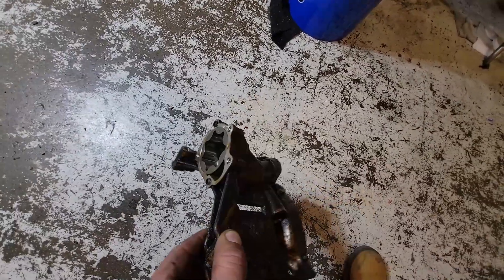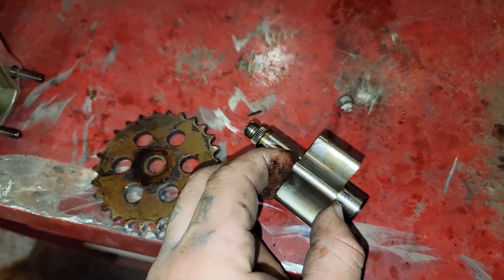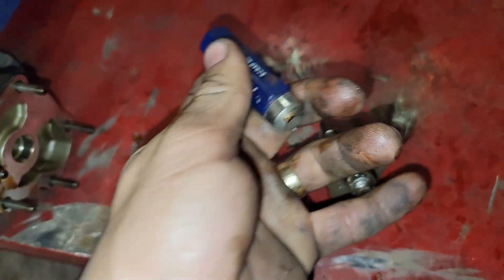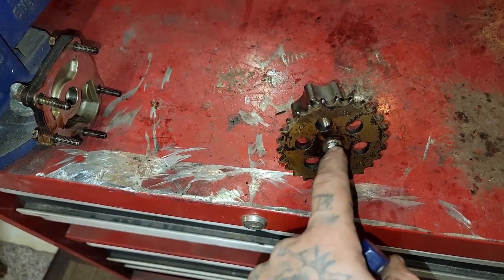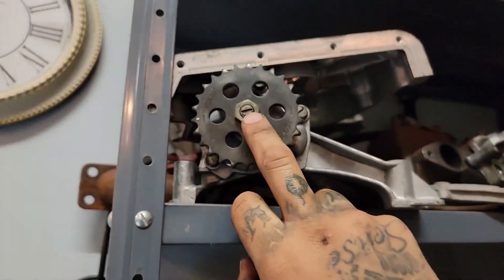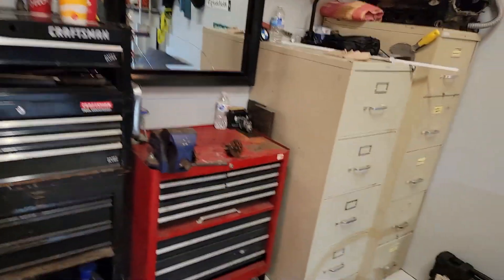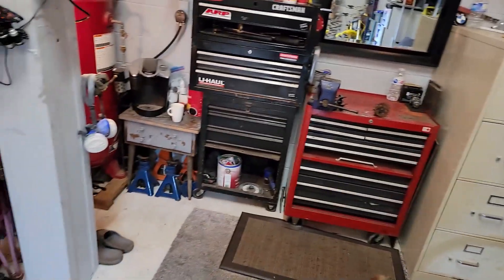Check this out — here's my oil pump and its housing. The housing is aluminum, and then the pump itself and the compressor section are steel. Since both the pump and the compressor section are steel, instead of using an oil tie-down nut, I'm going to crank it down, put a nut on there, and weld it to that. I'll torque it to spec and use Loctite so it will never back out. For the B30, I'll use the oil tie-down nut because that's going to be really high horsepower and I want to be able to service it.